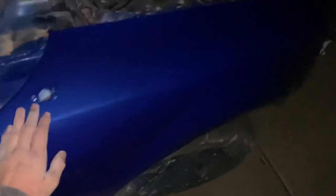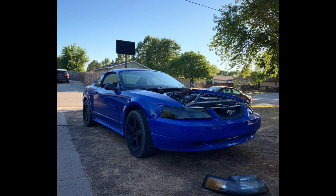All right guys, we got the car outside and first thing I'll say is it's looking pretty dang good. There is a little bit of dust in the clear coat and there's a little bit of orange peel, so we're going to have to sand that down with some 1500 and 2000, then buff and polish it out. We'll hit it — I don't know if we ceramic coat it or not — but that is going to be it for the video. Thank you for watching. If you'd like to see a part two or more content like this, make sure you hit that like button, subscribe, and hit the bell notification so you know when I upload. Peace.